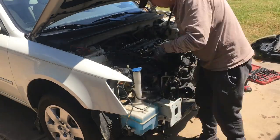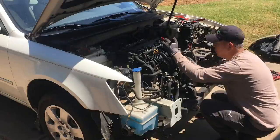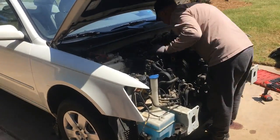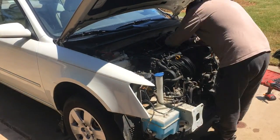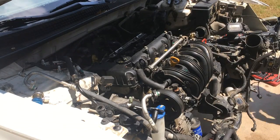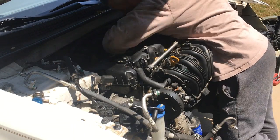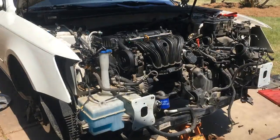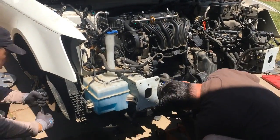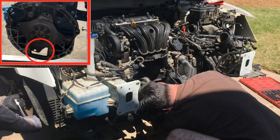With the front end removed, I disconnected all attached electrical connectors from the engine and moved the electrical harness off to the side. That was followed up with detaching the fuel line from the fuel rail. The exhaust system is detached by unbolting the nuts that hold the catalytic converter to the exhaust flex pipe — I was able to do this from above the engine instead of crawling underneath the car. Before unbolting the engine from the transmission, I removed the four bolts that link the engine to the transmission torque converter through an access port in the bottom of the engine.